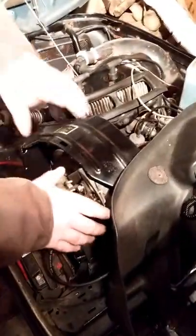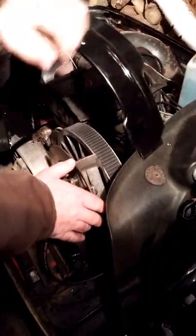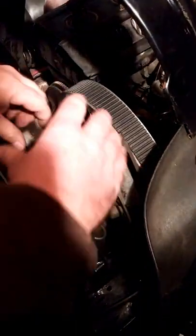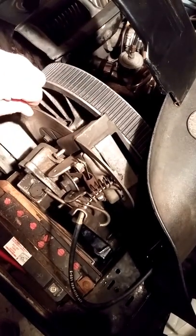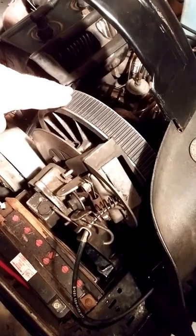It's got a disc brake system and we're trying to replace the pads. With the clutch cover off, this is the caliper system. What it does is clamp on the disc when it's turning — you pull the brake, this lever pulls in here, and it squishes two pads together, grabs the disc, and slows the machine down. It's mounted off the secondary clutch.